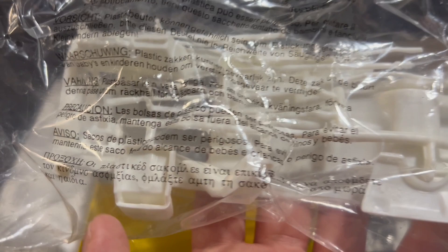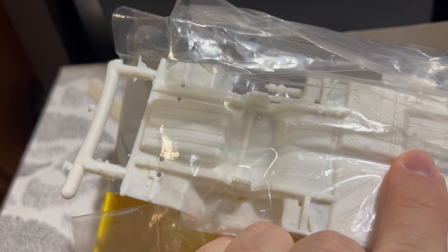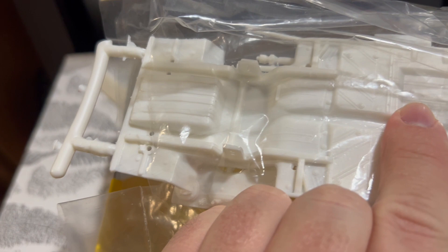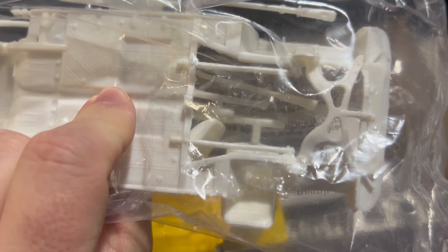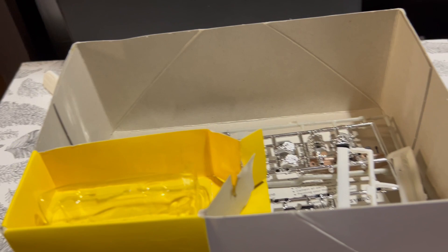Let's get to the chassis. The frame's not too bad. As far as I know, there's no rear differential — it's just a metal axle that goes through two holes. Kind of weird that they did that, but they did all this work up front on the cross member and the torsion bars and all that. Figure that one out.